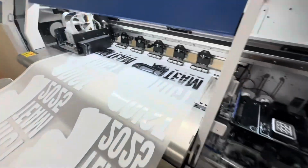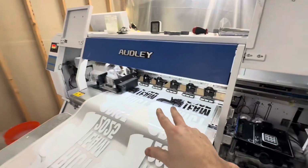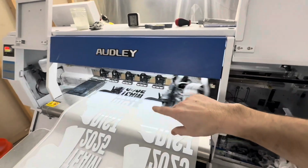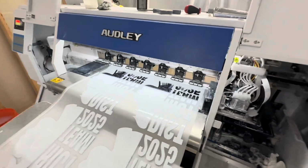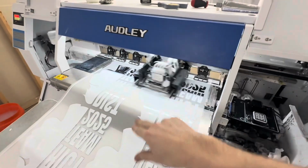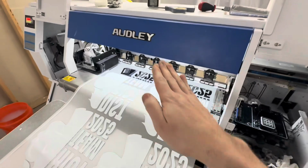There are also some other things that might be happening if you're experiencing those things, like your paper might be slightly pinched in the middle. If you're noticing that right in the middle is where you're experiencing blurry prints, sorry, my air compressor went off, that could be something else. That could be because your paper's pinched and raised a little bit.